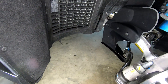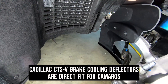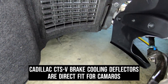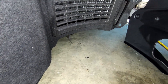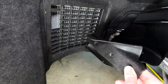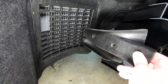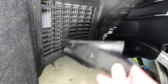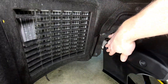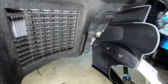Additionally, we've installed CTS-V brake cooling ducts that will give all the airflow coming out of this secondary radiator, including the factory brake duct. The factory piece is like one-third the size of the new CTS-V piece, but it has the exact same bolt pattern, so it's a direct fit. It takes about 15 minutes to install.